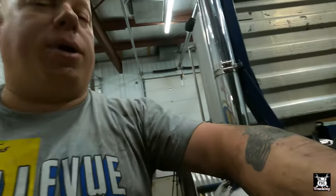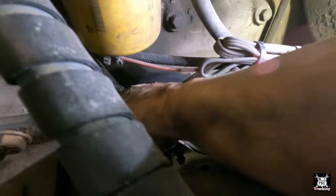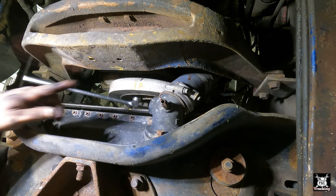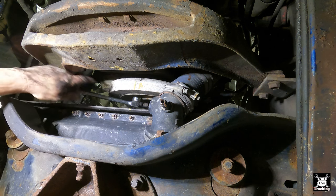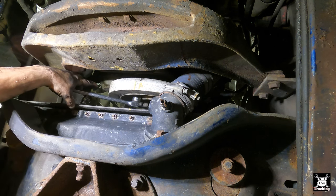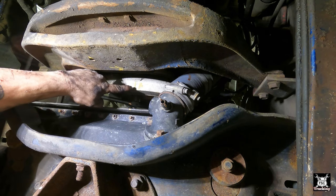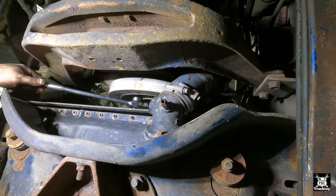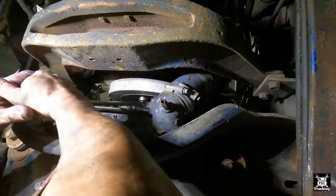So let's go ahead and spin it around. First, we pull the pin, and we'll get at it. Here's your pin, well, screwdriver in this case. Pin, slide it out, set it on the APU. Alrighty, now we're under the engine. What I did is I marked an arrow with a paint pen facing that way. See my mark? There's two marks on it, one seeable from the side and one seeable from the bottom. Basically, I line this line up to the center and that line right there. I've already got the breaker bar on the engine, so I just spin it easy.